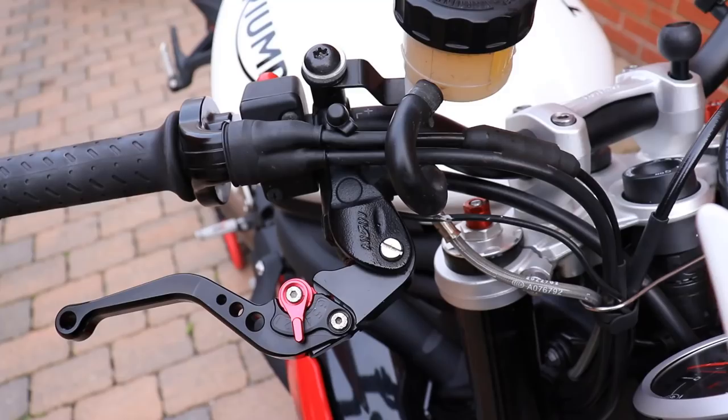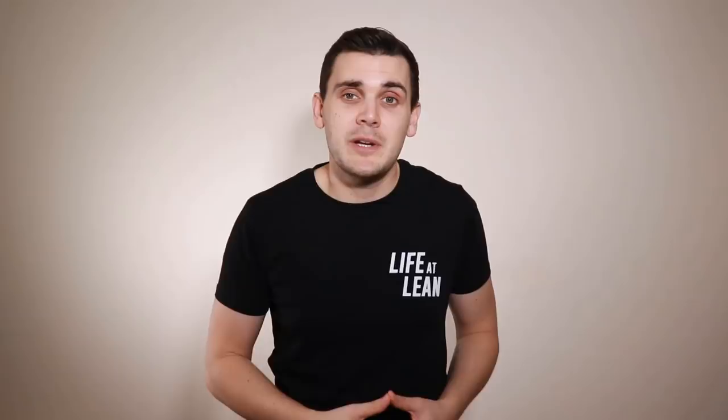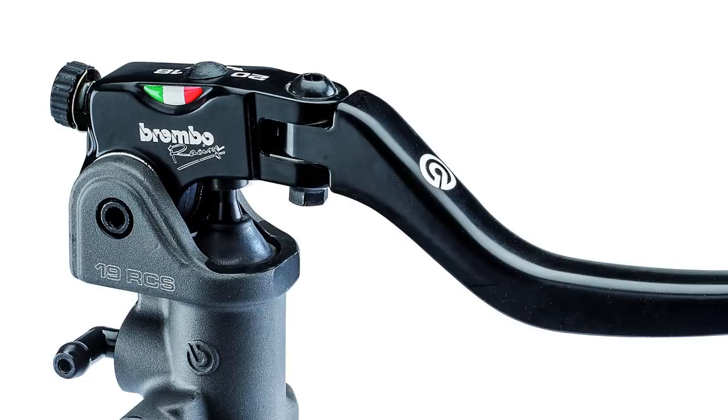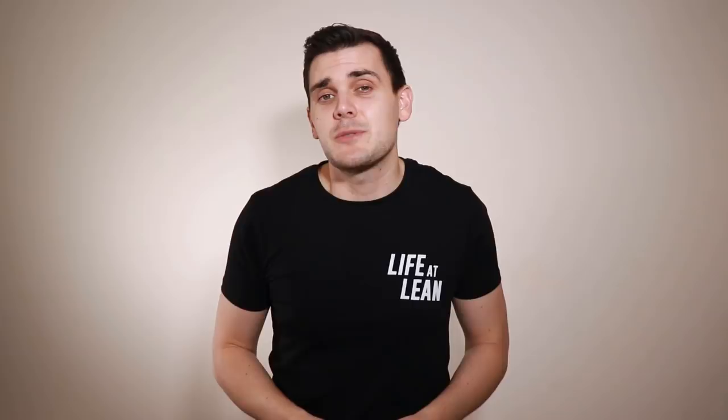Next: an upgraded master cylinder. Depending on what's fitted to your motorcycle as standard, an aftermarket master cylinder will likely bring the biggest gains when looking to upgrade your motorcycle's braking system. Their often larger piston diameter means that more fluid can be forced out of the master cylinder, which in turn means greater pressure produced. The downside of a bigger piston is that it would actually take more effort to produce this pressure. But due to the different lever positions and leverage offsets that the manufacturers employ, you can in fact achieve this higher level of produced pressure with the same, if not less, effort than using stock parts. These are a more expensive upgrade, but speak to anyone who's upgraded to an aftermarket master cylinder from a well-known manufacturer and they'll likely say it was well worth the investment.